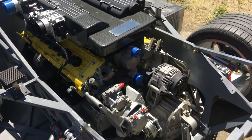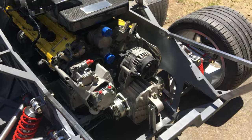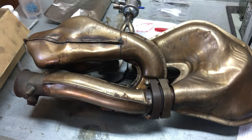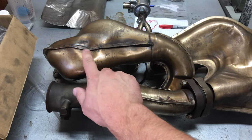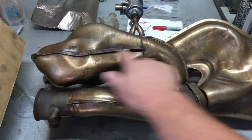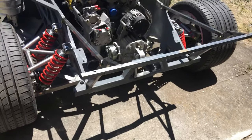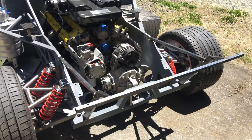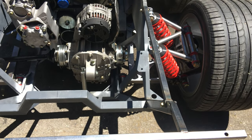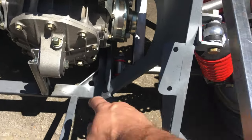The first issue I had was the headers had to come off on both sides. The engine cradle is too narrow to allow for both headers to fit. You can even see Lamborghini hammered that flange over — I don't know if they did that on purpose for clearance or if they just flattened it in the process — but it was tight, and for the replica chassis they were a no-go. So I'll have to make custom headers; I'll build them out of stainless steel. I didn't want to do that now, but it'll be fun.